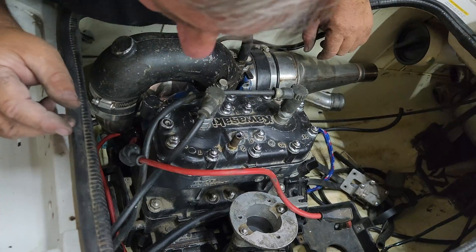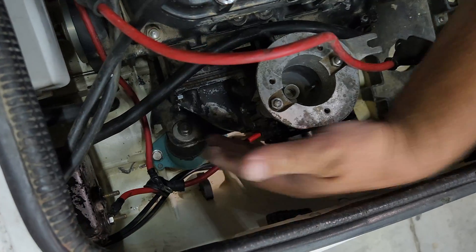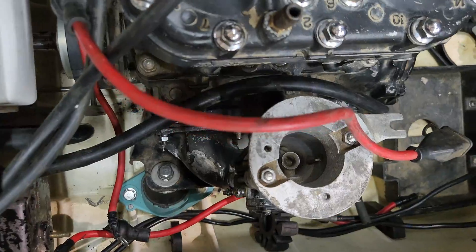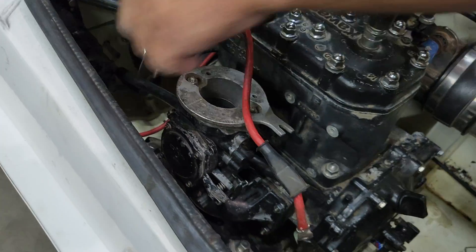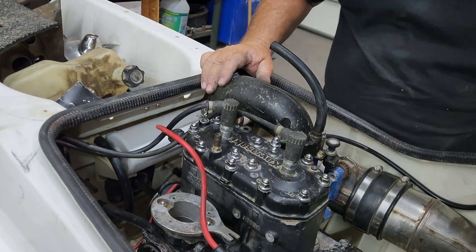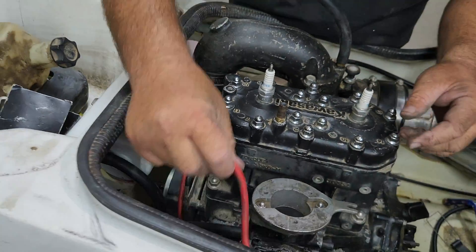But still no ground cable. And it looks like the electrics are all kind of botched up anyway. There's no wiring anywhere. I don't even see stator wiring — so there's not even a stator on the ski. But here's the hood latch — that's positive, and it's intact. So I'm not really sure what to think about the electrics. The motor's got to come apart anyway. We have no juice, none of that.